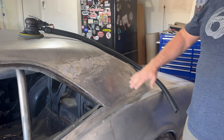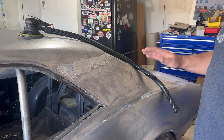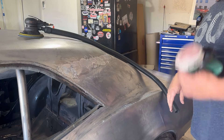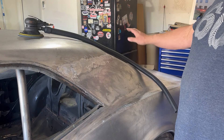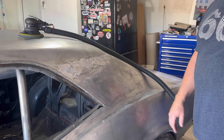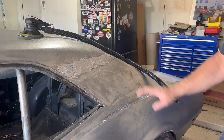As I mentioned earlier, you're messing with lead. I do have a fan down here pushing air, but when I sand it I want to make sure I wear my painting respirator just to be safe. I'm going to knock this down with 60-grit. Even with the vacuum hose on here, it's just a little extra precaution when you're working with lead. Let's get this sanded down.